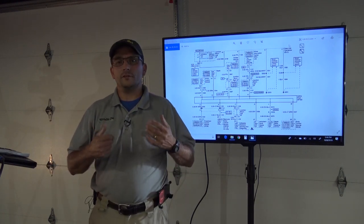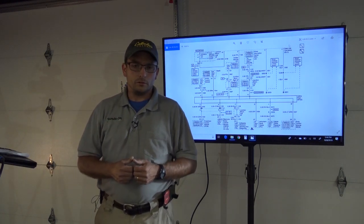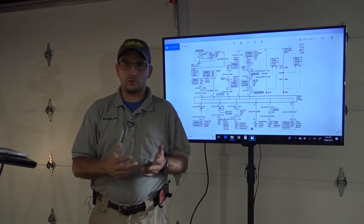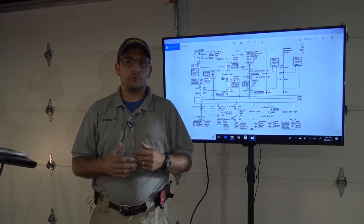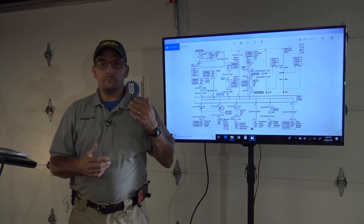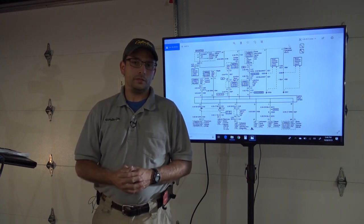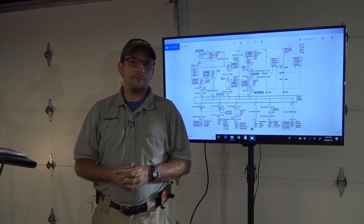The customer says that intermittently, the vehicle won't start. We couldn't get out of them whether that's a no start, a crank no start, you know, no crank. We really don't know for sure what's going on there. So the first step in my diagnosis is always to try to duplicate the customer complaint. And this vehicle started every time for me.